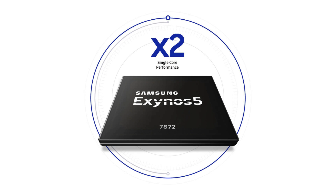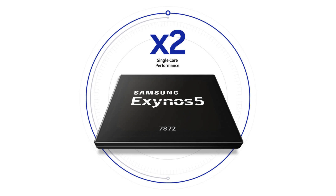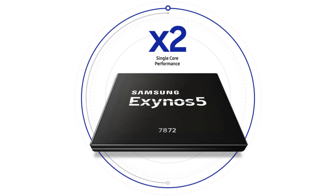But what Samsung have done this time with the Exynos is that it's a hexa-core setup with two Cortex-A73 processors. The Cortex-A73 is a good, fast processor. They've sacrificed the space of those four cores and put in two much higher-performing cores. What that means to the average consumer is that the user interface will feel much more fluid, downloading web pages will feel much more fluid, anything that is single-task-focused will feel much faster. And of course, there will be situations where all six cores are firing, and even those will feel very fast.